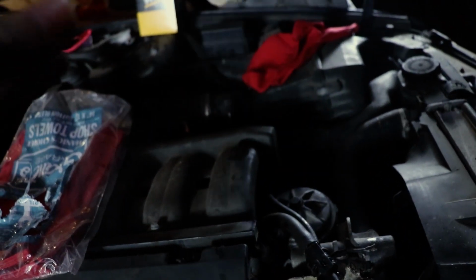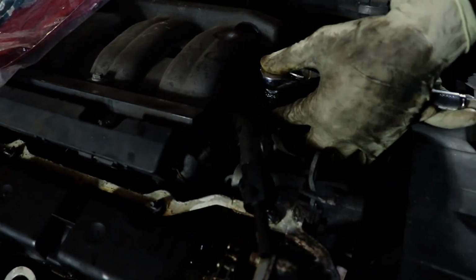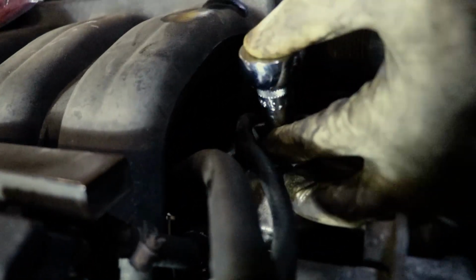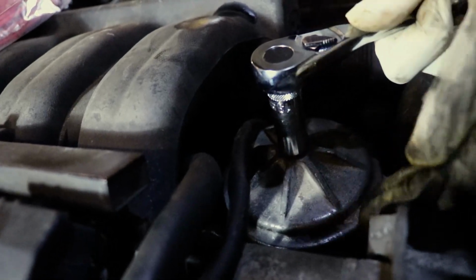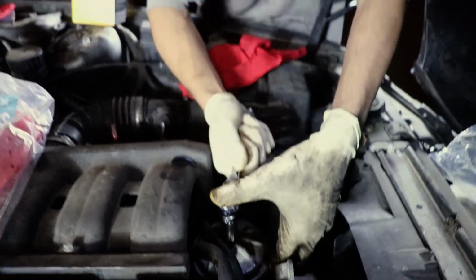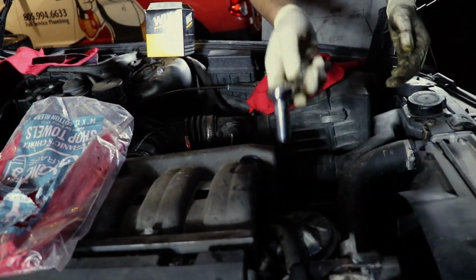There should be a little bit of play in there. Tighten the rest of the way down, that's pretty much that. I just go until tight. Usually on the plastic filters, it's 25 newton meters of force, but here, just go until it's tight. It's a rubber seal and just a bolt. You don't wanna snap anything. You don't wanna take your chances. It feels good. All right, cool.